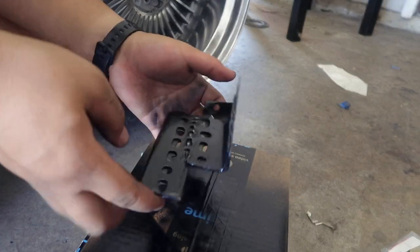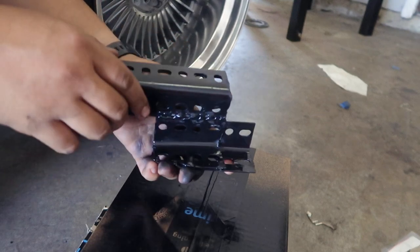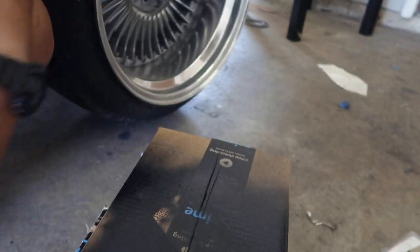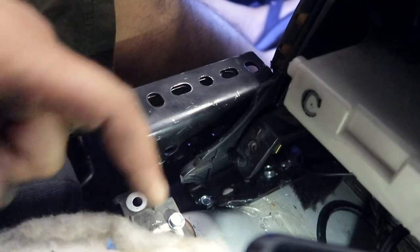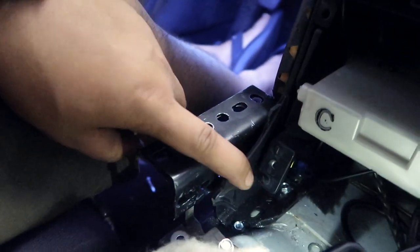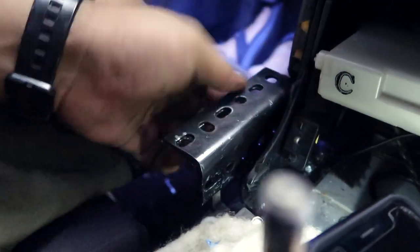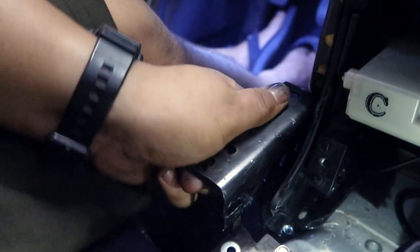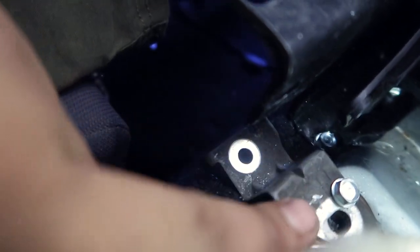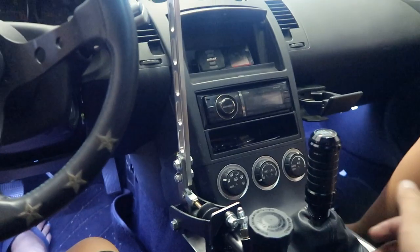The bracket is finished — I grinded down all my welds so it's nice now. I'm gonna go ahead and test fit this in the car. I just have three self-tappers: one up there, one here, and then one drilled in by the shift boot. I have the bracket set so my center console can still fit, and I did not have to cut any of my interior pieces. I also found an extra bracket in my pile of bolts that fit perfectly with the bend, making it a lot more sturdy.